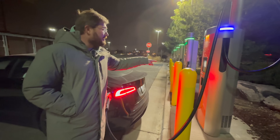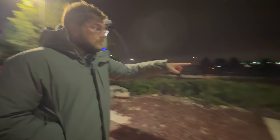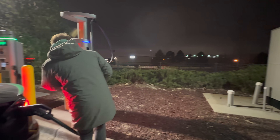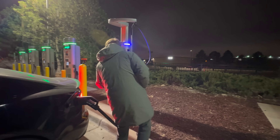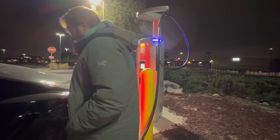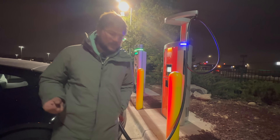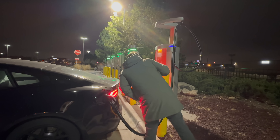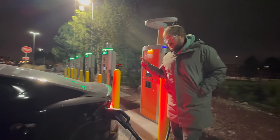Heard a contactor click here in the dispenser. Eight percent state of charge. I hear the power cube spinning up over here, which is pretty sick, and now we are charging at 143 kilowatts, 144, 145, and seemingly ramping up. Super fast reaction time to plugging in — that was less than 30 seconds, so I'm very pleased. We're doing 152 kilowatts at nine percent and we'll just let it do its thing.